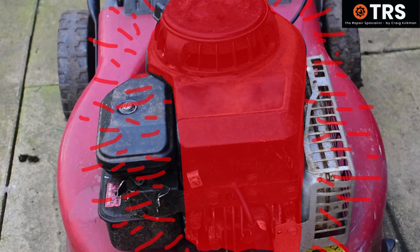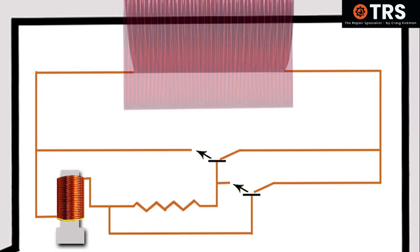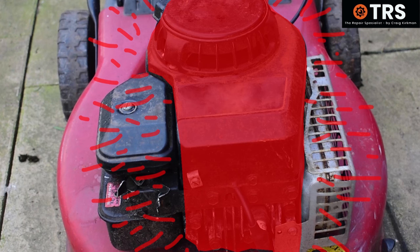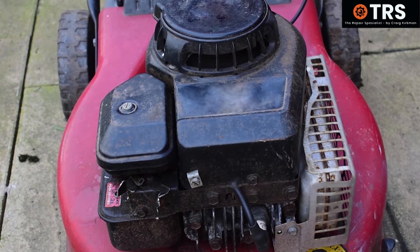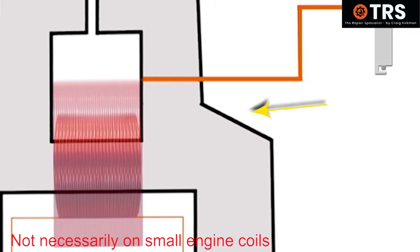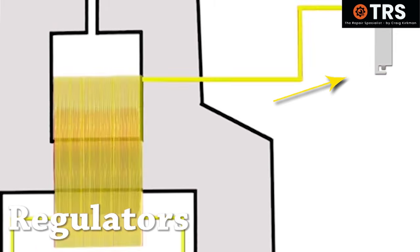As well as heat damage to the coil and the insulative material, there are other delicate components within the coil — such as resistors, transistors, and diodes — that would undoubtedly get damaged due to overheating. Without overheating of the engine, can there still be heat damage to the coil? The answer is yes. The ignition coil itself, particularly the more advanced ones, is able to modulate and regulate the amount of current produced to be given to the spark plug, so these regulators within the ignition coil module ensure the spark plug is getting enough current to produce a sufficient spark.